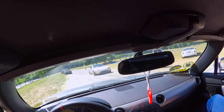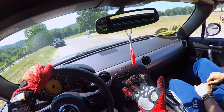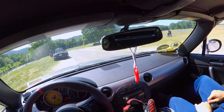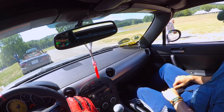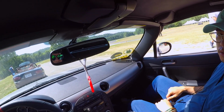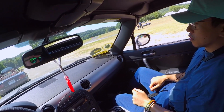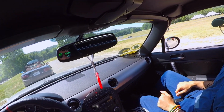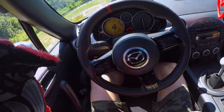But when you get to that point as a driver where you develop more, and you want to play around with the throttle and drive the car with the rear tires, having more front camber and less in the rear is going to be very helpful for that. And your toe probably either 0 or maybe 1/16 of an inch in the rear, and that will make it a little bit more stable too when you're in oversteer situations. But other than that, it's a really good car.